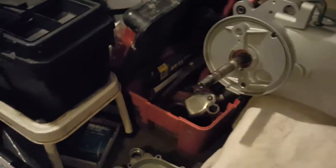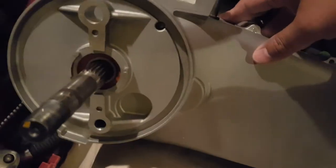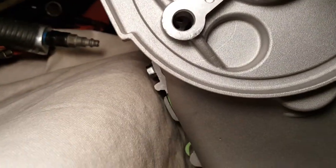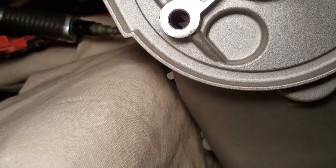I put the cylinder back down for a second because we need to work on some components we forgot. As we were tightening our transmission cover and putting in the transmission gear, we forgot there's a hole in here that's supposed to be filled up with a brake guide. Even though we don't have the brake shoes, it still needs to be filled. You can see the hole right there and probably all the gears in there — that's one of the gear pockets.